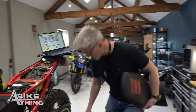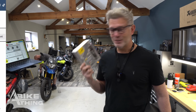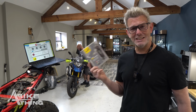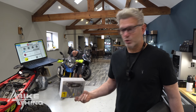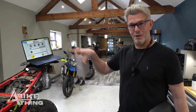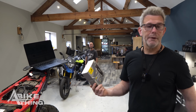By the time you see this video, these will be on the website, so you can order these. You can plug them into your ezCAN. If you've got a shaft-driven bike, you don't need it. But if you've got a chain-driven bike, and you've got an ezCAN or a CAN Smart or even a Lone Rider Moto CAN, this is compatible with it. We're selling these on the website, so you know where to grab one. You can get a Scottoiler that will just work the conventional way, but this is the latest technology where it works in conjunction with the ezCAN, and we can program it just the way Tom's shown you. If you didn't have the ezCAN, it probably wouldn't do the 10 miles per hour thing. It just constantly drips.